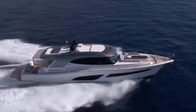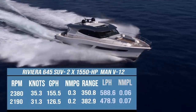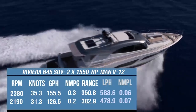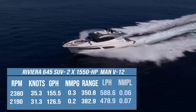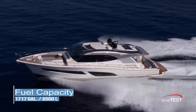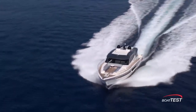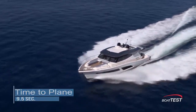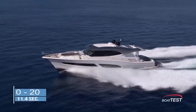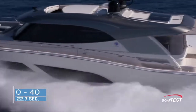There's no real best cruise per se, but if we run her at the recommended 80% load at 2,190 RPM, she'll cruise at an average 31.3 knots. At that speed, the combined 126.5 gallons-per-hour fuel burn gives her a range of 382.9 nautical miles, all while holding back a 10% reserve of the boat's 1,717-gallon total fuel capacity. In acceleration tests, we reached planing speed in an average 9.5 seconds, and she'll hold plane right down to 11 knots. With the throttles pinned, we cruised through 20 miles per hour in 11.4 seconds, 30 in 15.2 seconds, and hit 40 in 22.7 seconds.